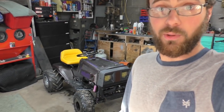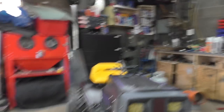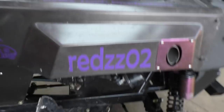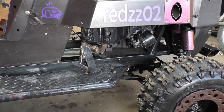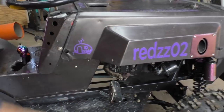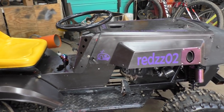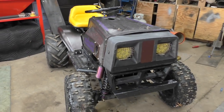The Haspin build is officially done. So to start off, it's a Dynamark. The frame is a one-by-two square tubing chassis that I built, very similar to the stock chassis. Size-wise, lengthwise it's exactly the same. The width in the back had a little bump out and then it got skinnier up front — I actually made the whole entire frame the same width as that back bump out, so that's the only difference.